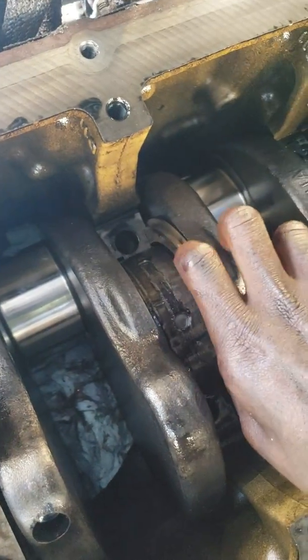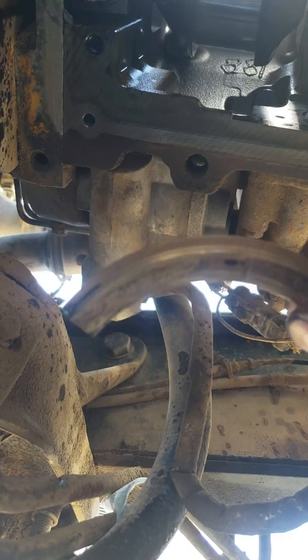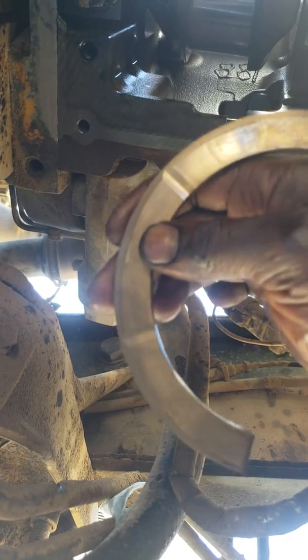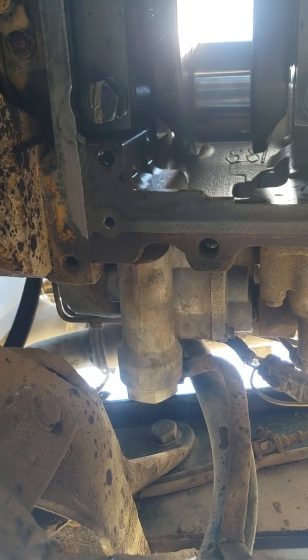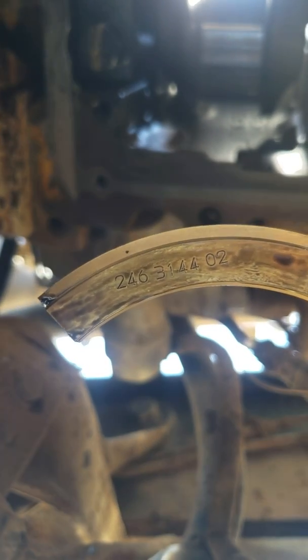Also glad I did this one — just the first washer in here. I take this, you can take that out too, it doesn't really matter. Now remember on these, they have a block side and a crank side. Those oil spaces there go between the bearing and the crank, and the step side — the numbers go towards the block.